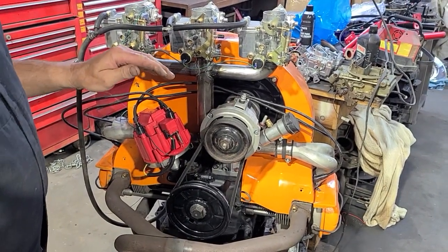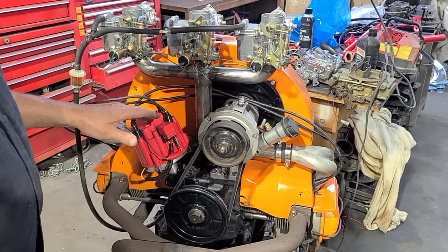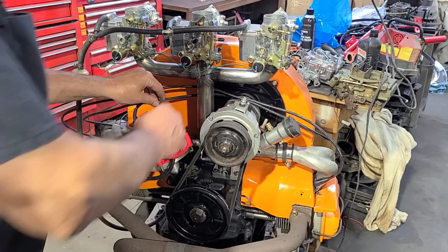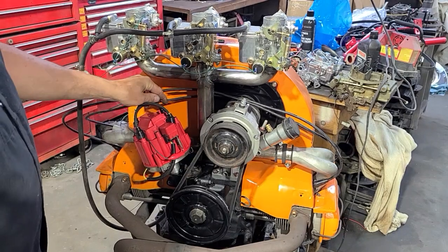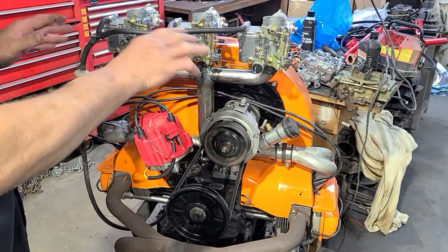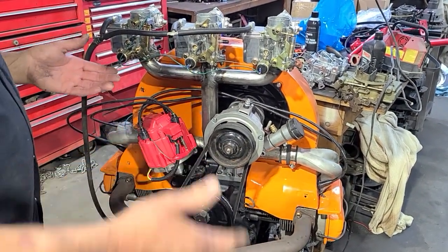It was missing at the higher RPM and giving a little bit of black smoke — this HEI took care of that. I love these HEIs; I've probably made 100 to 150 of them over the years and everything I put them in just works wicked cool. My wires are not properly put on here because I don't have the correct attachments, but I'm impatient. I'm going to run all three carbs at the same time and then show you the exhaust.